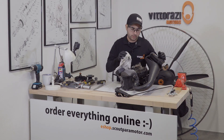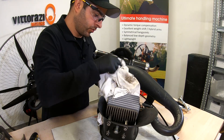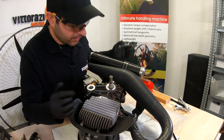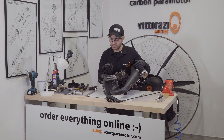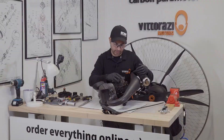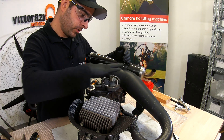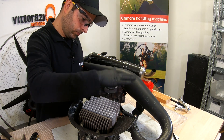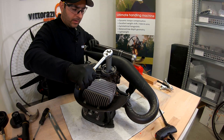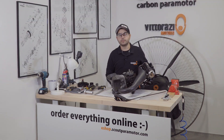The clutch is out. Now be sure that you clean the surfaces and inspect for wear and damage. We have no oil leaks, everything is perfect, it looks like new. Now we will install the new clutch. Installing the clutch is just as simple as screwing it in. Be sure that you catch the thread correctly so after doing that it should go very easy. Just tighten it a little bit, so you're sure that when you first start the engine it won't get unscrewed. Now let's put everything back together and we are done.